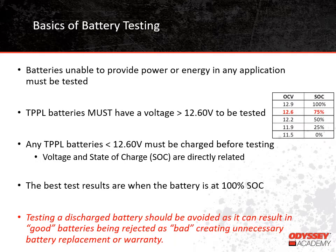Before we talk about different battery test methods, there are a few points that apply any time a battery is going to be tested. We want to test any battery that fails to provide power in an application, because testing is the only way to find out if we have a battery issue or an application issue. Replacing a good battery doesn't solve anything. In order to get good test results, the battery must be at a high state of charge. For thin plate pure lead batteries, the battery must be at 75% state of charge, which is about 12.6 volts. You can see the chart here where we relate open circuit voltage to state of charge. One note about open circuit voltage: in order to get an accurate reading, the battery needs to have been off charge for at least four hours.